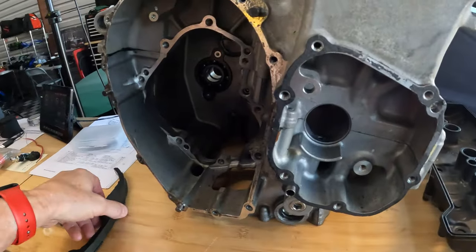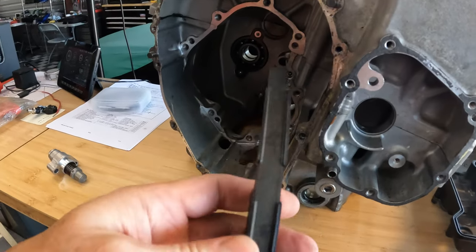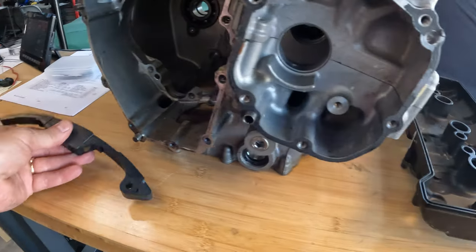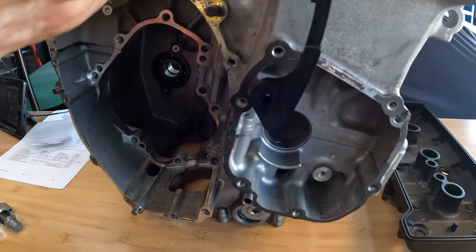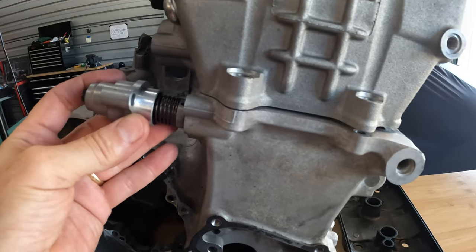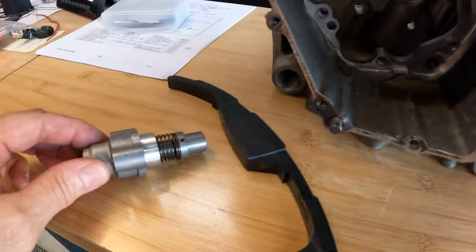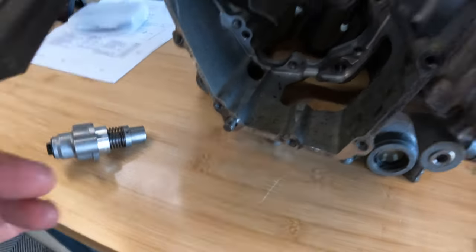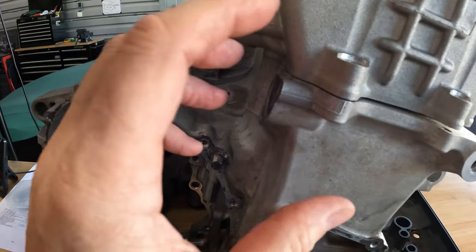Here's an example of an OEM tensioner — you can see they're kind of spring loaded, and I think they have oil that goes up inside them. Here's a dummy block, an old engine I use for exhaust setup. Here is one of the guides for the chain itself — there are actually two. You have one on this side of the engine going up the side, and another going in on the other side. The chain tensioner — whether manual or OEM — controls the slack in the chain directly through this guide.